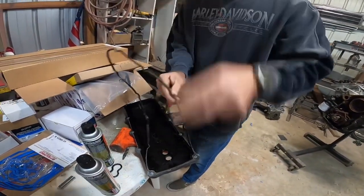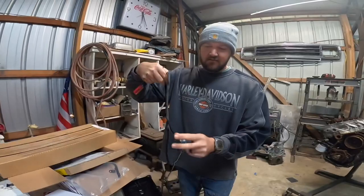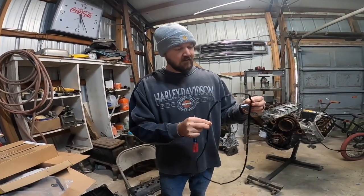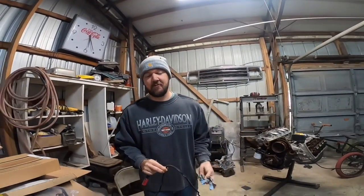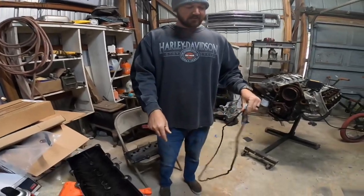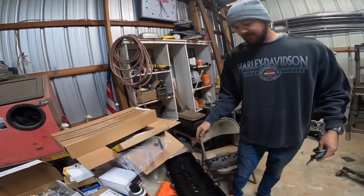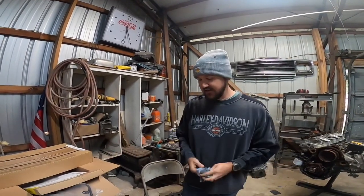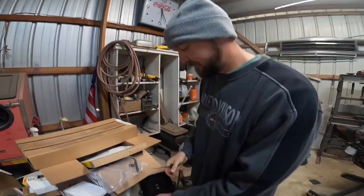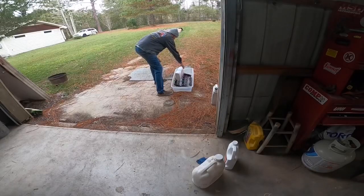Do you think they replaced that at some point before? It's a 120,000 mile motor. That's relatively a low mile engine. But you can see all this is still pliable. You want to get all of this stuff off, and then we're going to throw it into some Purple Power so it can soak and clean well. We'll scrub it and clean it up before we put the new gaskets back in. So I'm going to break all these down.